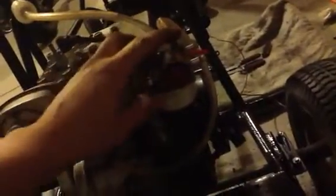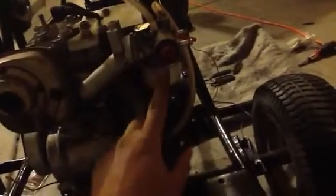What I did was I grabbed the Craftsman's gas tank with a fuel filter and hooked it up over here from where the extra fumes come out — hooked it up to this little line up here. I was having issues getting this thing to start but now I got a new o-ring for the carburetor after I cleaned it and now it starts right up.